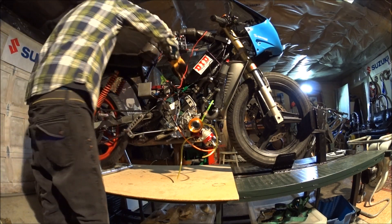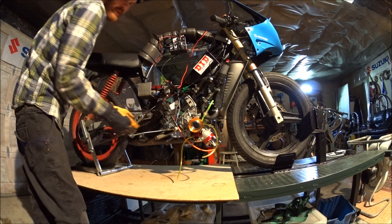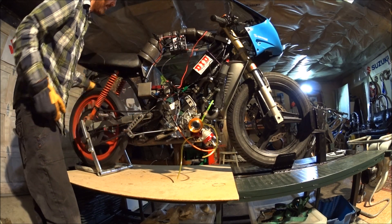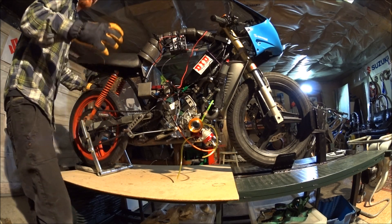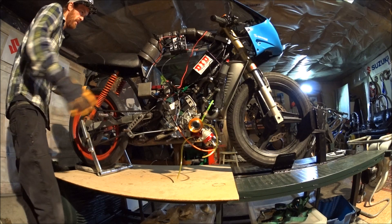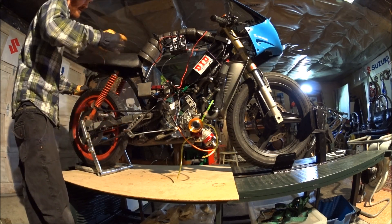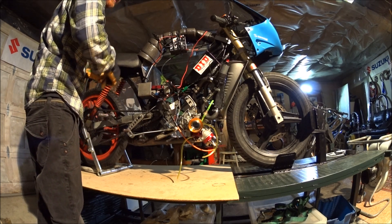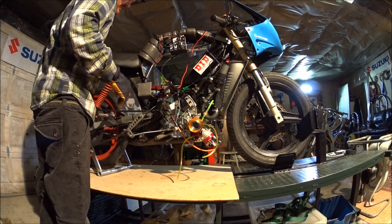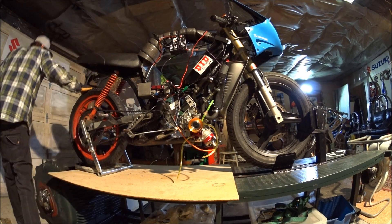So the way I start it — there's a small button on the clutch pulley you can press in. There's a brace that locks the pulley so the clutch is locked. Then you can start it, and when the engine starts turning, that pin flies out and disengages — the clutch disengages.